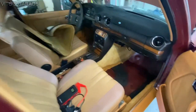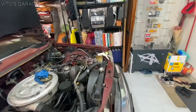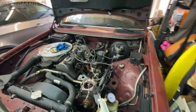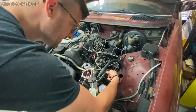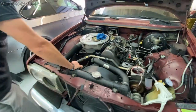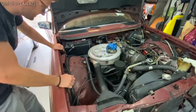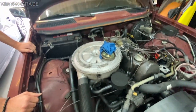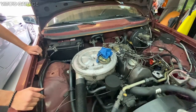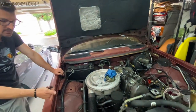He's also working on the engine bay doing a power steering flush. One of the lines — you can see it — yeah that's a return hose, all of them are like that. Probably need to tighten up the alternator too — this belt is super loose. See if that's the reason why it keeps dying. Did you check the voltage while it was running? It'll jump and then if I drive it around for a while, it will start on its own once, but then that's it.